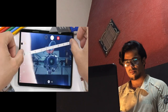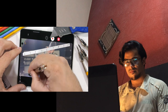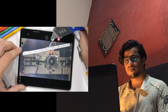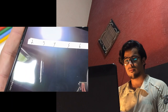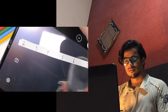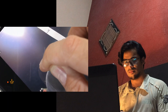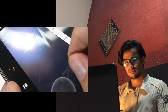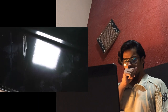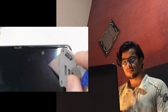Samsung has said that with this Fold 3, their middle screen is 80% more durable than last year's, which would be pretty impressive. The Mohs scale isn't the best scale to use on different levels of plastic — no matter what plastic it is, it'll all fall between level 2 or 3. We would need something like a shore durometer to fine-tune that scale. As of right now, we're still getting scratches at a level 2 with deeper grooves at a level 3, and my fingernail is still able to leave very noticeable marks on the surface. The display underneath the plastic might be 80% more durable, but it's still very soft on the surface. The front camera is also tucked underneath this soft plastic layer and could get scratched — all 4 megapixels of it.